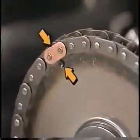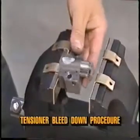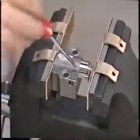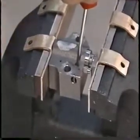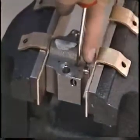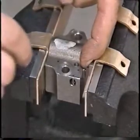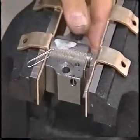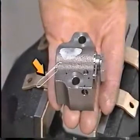Note: it is necessary to bleed down the timing chain tensioners prior to installation. Care must be taken when bleeding the tensioner down. Position the tensioner into a soft-jawed vise. Using a small pick or similar tool, hold the ratchet lock mechanism away from the ratchet stem and slowly compress the tensioner plunger by rotating the vise handle. Once the tensioner plunger bottoms in the bore, continue to hold the ratchet lock mechanism and push down on the ratchet stem until it is flush with the tensioner face. While holding the ratchet stem flush to the tensioner face, release the ratchet lock mechanism and install a paper clip or similar tool in the tensioner body as shown. This locks it in the collapsed position.